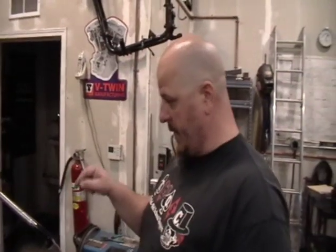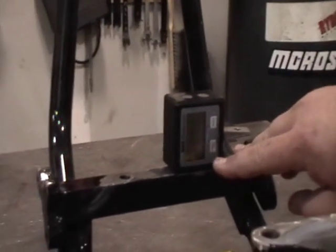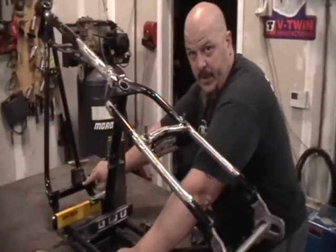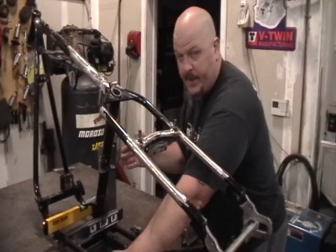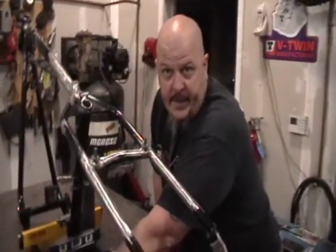What I'm going to do is take you through the steps — just really quick, dirty checks to see where we're at. We started by putting some blocks under it and shimming it so that the front motor mount is sitting at exactly zero. Big T, if you can get a close-up of that — you can see the front motor mount is zero. This allows us to check: if the front motor mount is held at dead level, how do the other positions — rear motor mount, front trans mount, rear trans mount, and axle — line up? In a perfect frame, they should all be in that same level plane.